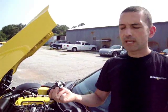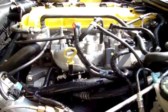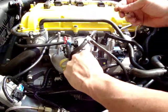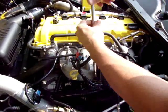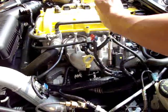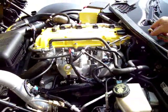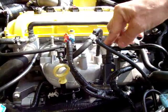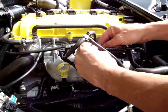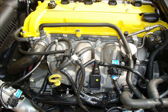The reinstallation is really pretty simple. You're going to take it and push it down into the intake manifold, take the bolt that you removed, and set it back into place. Tighten it down with the socket and snug it up. Once that bolt is back in place, take the hard plastic line - that's going to push down on top of that nipple and you'll hear it click into place. And once it clicks in, it's good. Then lastly, push the electrical connection back on. That's basically how to test and replace the EVAP purge solenoid on the car.